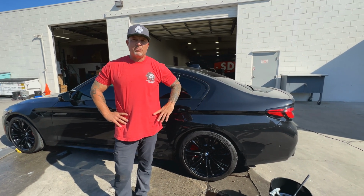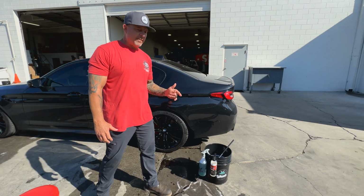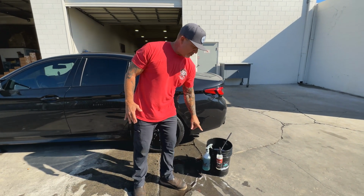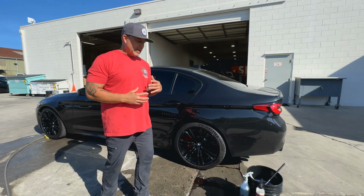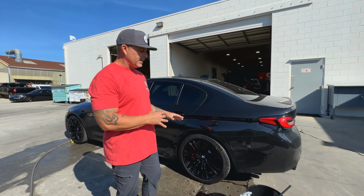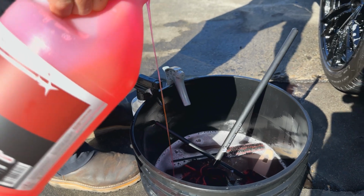All right, so I hope that helps give you an understanding of the difference between our two wheel cleaning products. A couple pro tips. One that will save you a little bit of money, I referenced in the beginning of the video: for heavy brake dust, use your Cool Guy wheel cleaner to break that down. And then for your weekly maintenance with your washing, use your Wise Guy as long as you don't have heavy brake dust buildup. Another tip is in your wheel bucket where you have your water, you're dipping your brushes in and out of while you're cleaning. You can put a little soap in there or some multi-purpose cleaner. It helps keep your brushes clean and boosts up the cleaning power while you're cleaning the wheels.